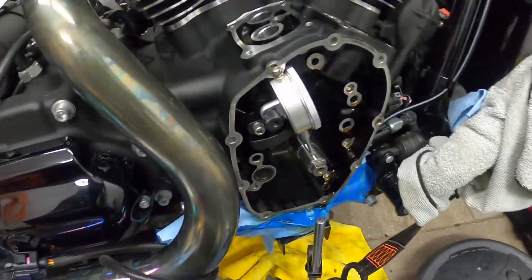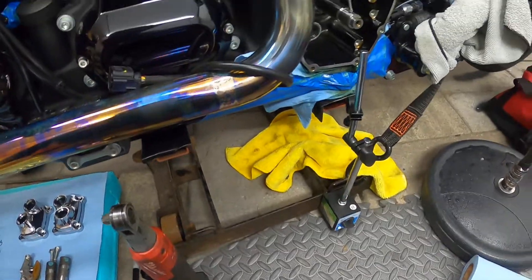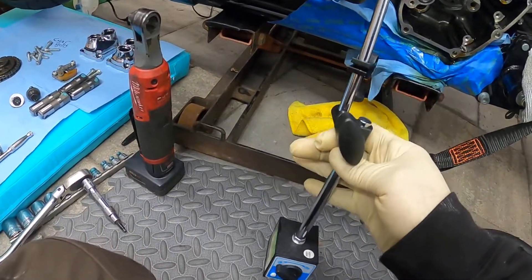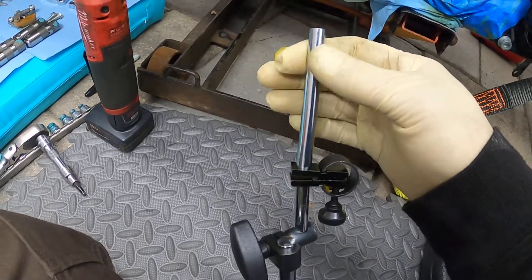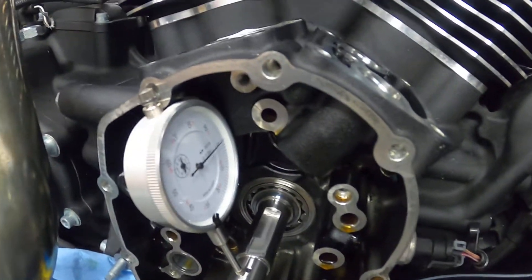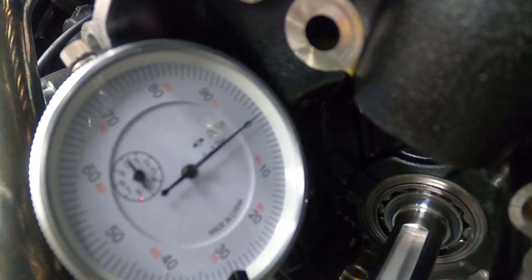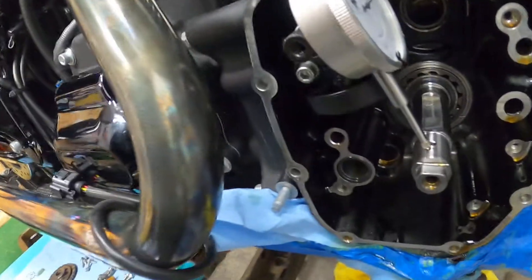I got my stuff cleaned up and better organized — I hate clutter. So I got a plan rig over here. I went to Harbor Freight and bought this magnet stand for about 13 bucks. The tip where the dial indicator bolts to — I used one of the cam plate bolts to hold it in. I got the dial indicator on the crank setup, zeroed it out, and it works. About 30 bucks total into it.